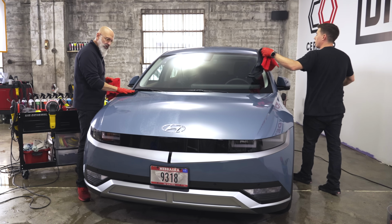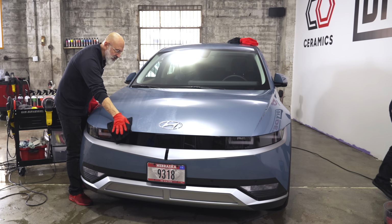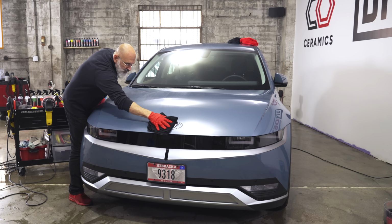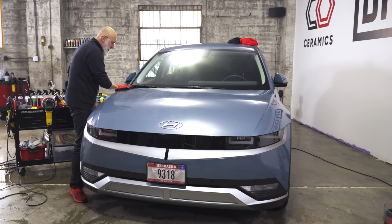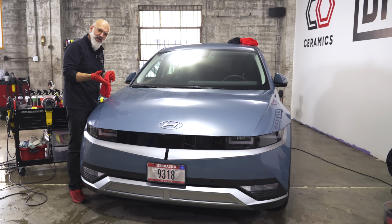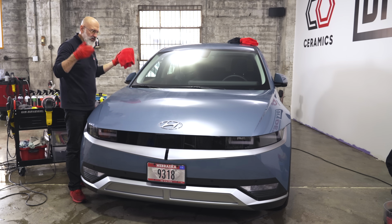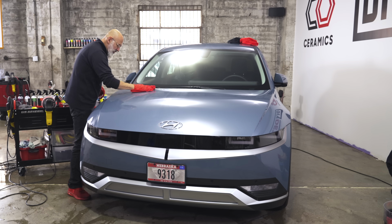Once we've polished, we use our rinseless dampened towel. Again, no pressure, no stress. Just lightly going over the surface. That's all you need. Work into that emblem. Make sure you have the whole surface with the rinseless. Then a dry towel. But you're not in a rush to dry it off. Let it evaporate a little bit. Let nature help you. Then, when it's about 50%, then you can go in and dry it. That way you're not moving water around.